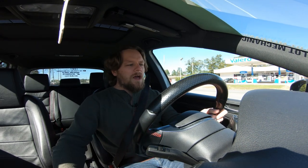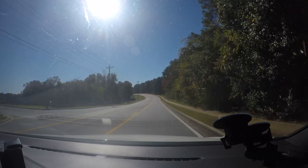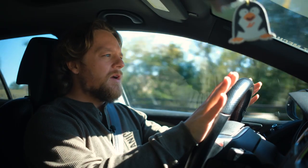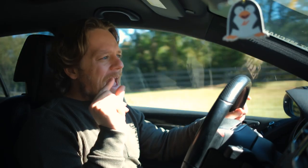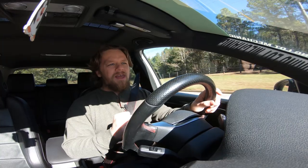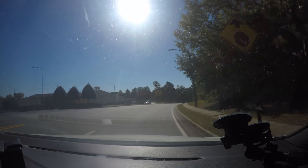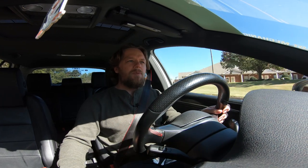But I'm interested to see, because I was reading some of the reviews and people were talking about how the turn in, when you put the fronts in, is just that much better. It's crisp, but I'm assuming it's better because of how the weight is distributed in the immediacy of turning. So without the locking collar kit, you've probably got just a fraction of amount of time where the weight is being shifted over before it locks in and you turn. But with the locking collar kit, that transfer of weight is minimized and you can just turn in and the whole car just doesn't move as much. So you're getting a more immediate response to turn in. And I am so looking forward to that.